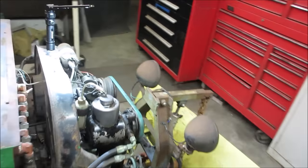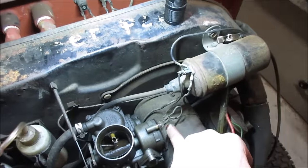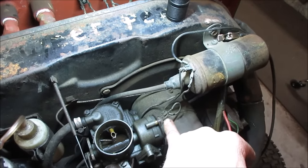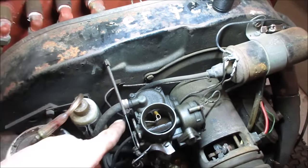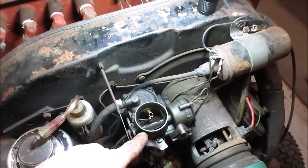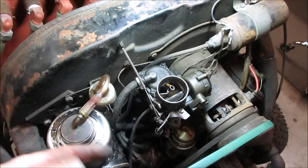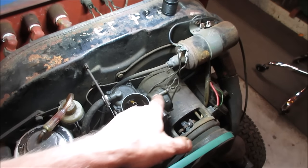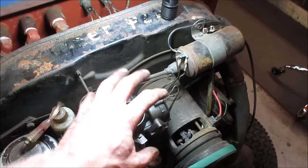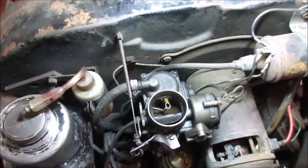A Volkswagen setup has an electric shutoff and an electric choke, which are these two right here. So just go double check, make sure they have power going to them. Somebody put a manual choke lever on it, so the electric part of it, I don't even think is set up. And then they have another one for the throttle. But let's see if we got power going to those. And then we'll maybe get this carb right off of here. We'll give her a little bit of love.